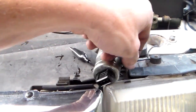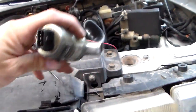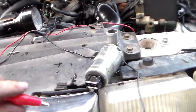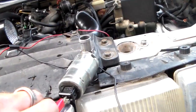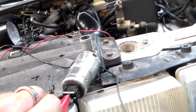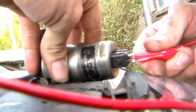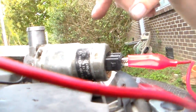This was kind of a silly design Volvo came up with — mounting this thing down in a loop under everything else rather than to the throttle body. So when this car spits oil through its system like it does, that oil goes right down and settles in this thing. Really smart, Volvo.